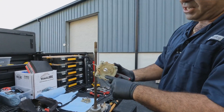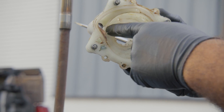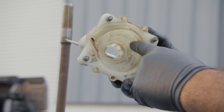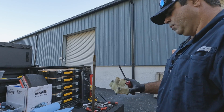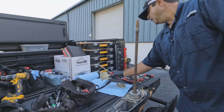This particular housing is in good shape, there's no melting. If this was completely melted it would partially block the output of the water pump. If it is melted, just replace it — it's not worth putting back on. This is a reusable part out of the kit.